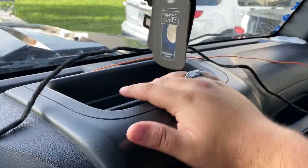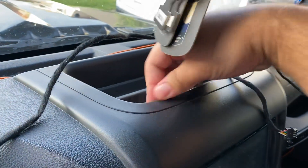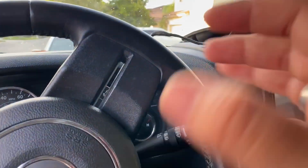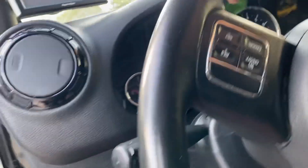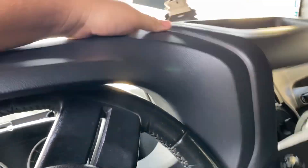If you do not have an aftermarket radio — or maybe you do, it depends — there's going to be one screw right under here. Same size and everything, just pull that one out. Once you've pulled out those three or four screws, the dash should come right out. I recommend you drop the steering wheel. Move the harness out of the way so it doesn't get caught up. You can put it from any side you want — I like doing it from the top towards you — just like that. The radio side is going to have to come up first.